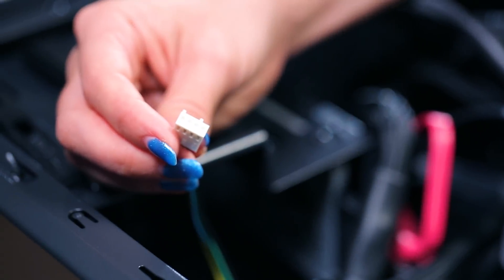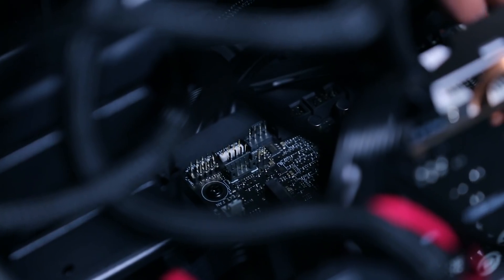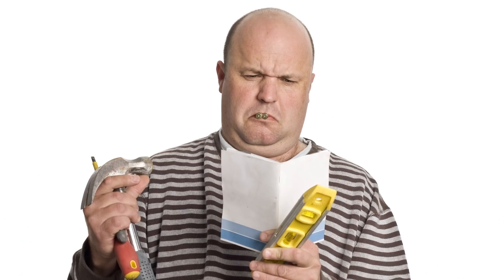Now on to wires — although often confused, they are different than cables. Connect the power wires from the CPU cooler and other fans to the correct pins on the motherboard; they're usually clearly marked. Connect the wires from the front panel to the appropriate headers. Connect the wires from the lights on your case, power or reset buttons to the pins on the motherboard. These are also normally labeled, but when in doubt, consult your motherboard manual.